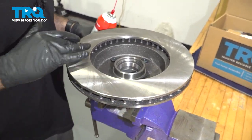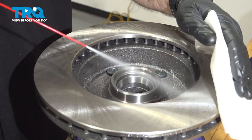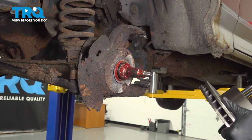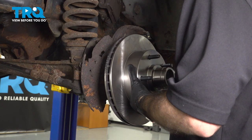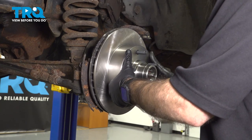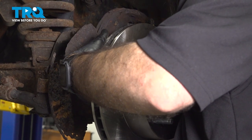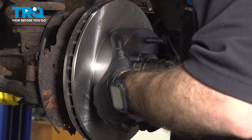Your new rotors are going to come with a coating of grease or oil for shipping so they don't corrode — we're going to brake clean that away. Now we're ready to put it on the vehicle. Now is the hardest part of the install: you're going to take your rotor, slide it up onto the spindle, and all the way back onto your inner bearing without letting go of your rotor — because without your front bearing it will come sliding forward. We're going to make sure our wheel seal is in place, and our rear inside bearing is also in place. Slide your rotor up onto the inside bearing and keep pressure there.